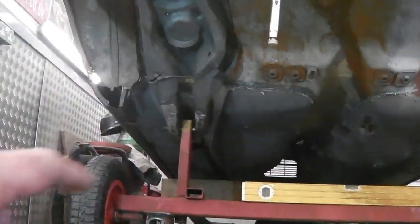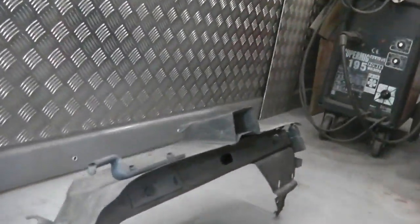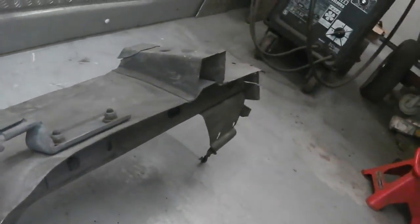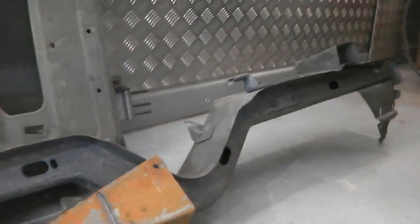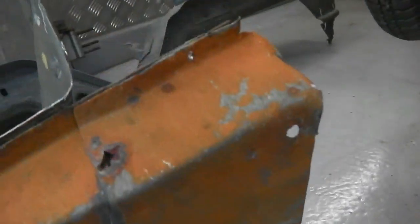This chassis leg needs its front extender piece so it can meet the chassis. And we'll find that down here. Look on this piece of floor, that's its original piece that was cut off. Because that chassis leg was part of this piece of metal from this car. And it was chopped like that so it could extract this humpback bridge thing, this cross member. Here's Bramble's original outrigger leg for under the boot floor. We need to clean and get off that piece of metal there because it slots into here.